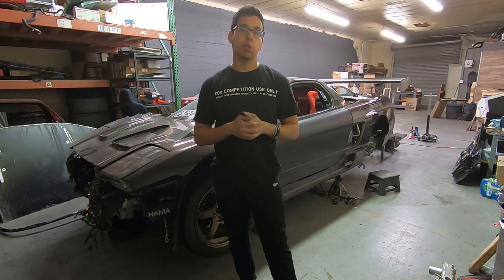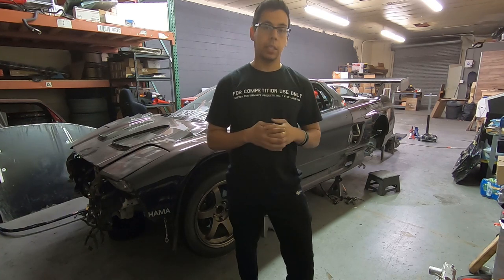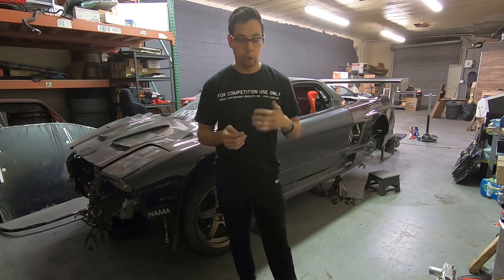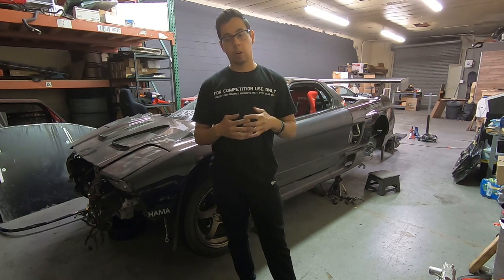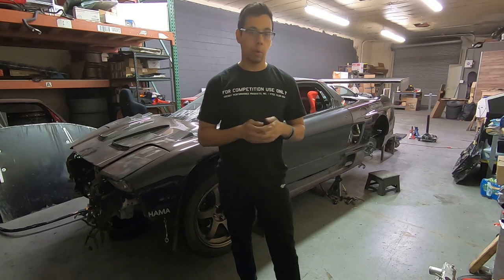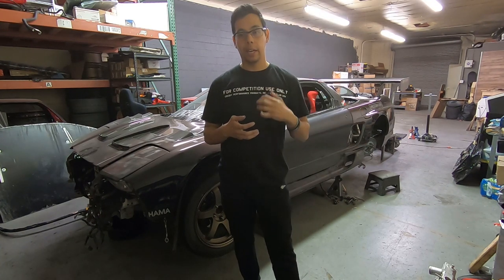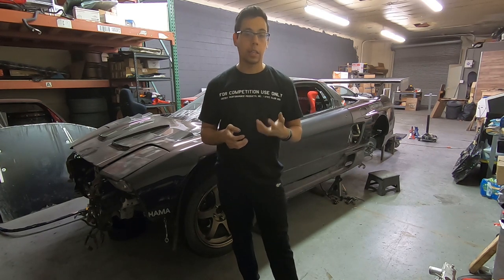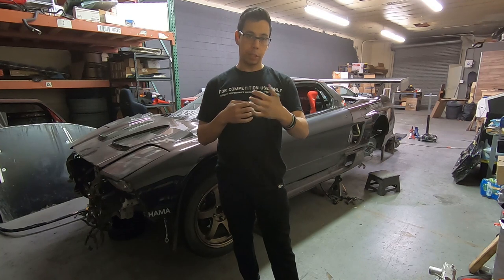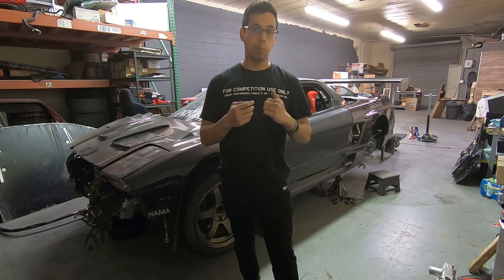The other advantage is that it's straight cut. So the straight cut gears have that cool whine, but the big advantage is that they are stronger. The straight cut gears are stronger for a couple of reasons. Number one, these are forged. And number two, you'll often hear people say that a helical gear is technically stronger, which is not wrong. That is technically correct because the amount of engagement you have in teeth with the helical gears, where they're cut at an angle, is more.